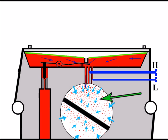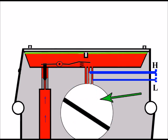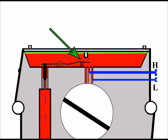So taking a look at the working scenario here, it's the same outlook as the last scenario. Each time the piston cycles, we've got less fuel going in. Each time the engine revs high, eventually we've got bogged down. And in this case, it's all because that lever is angled too far low at the back. Again, this is another thing that's often overlooked. So if you do suspect that your metering lever is over-adjusted like this, then it's easy enough to bend back into the right area because it's only made of a thin metal.